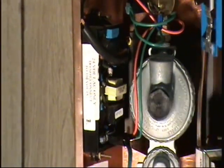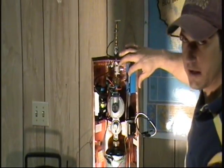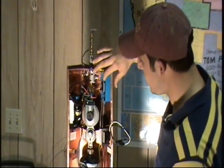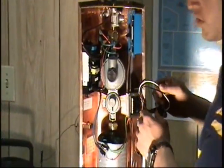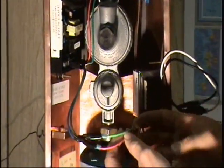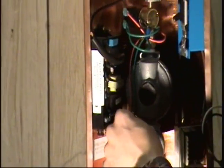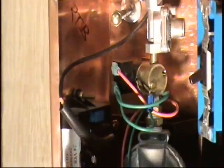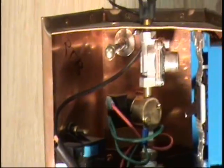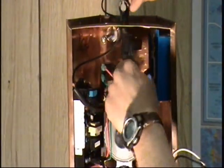This is the brains of the system. It all starts from this 110 switch. 110 volts comes out of this switch and energizes this transformer. When it energizes the transformer, the transformer sends a signal down these two wires through the wiring harness on the black box into the black box. That black box sends a signal out of this igniter wire as well as out to the solenoid.